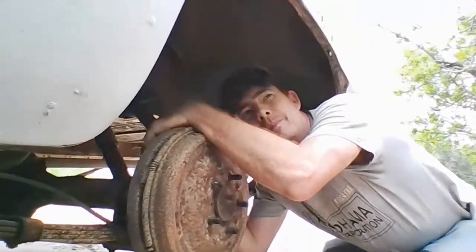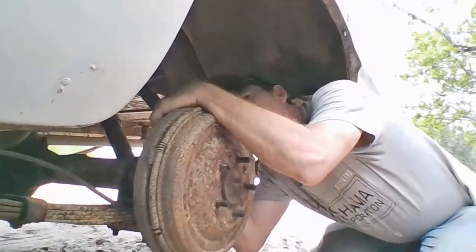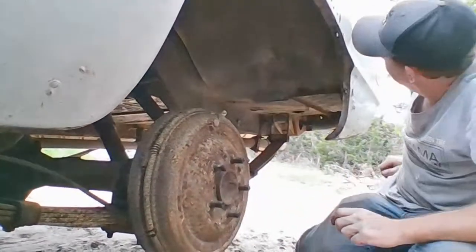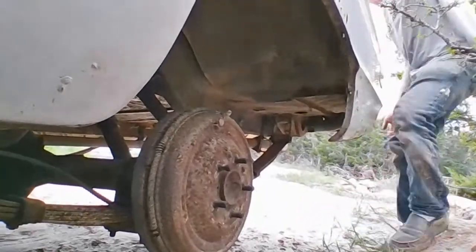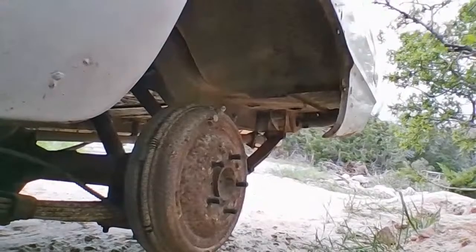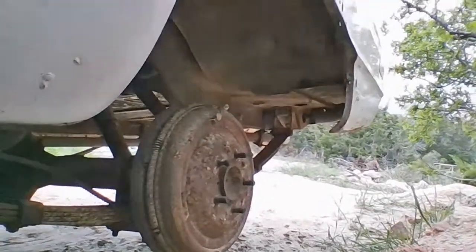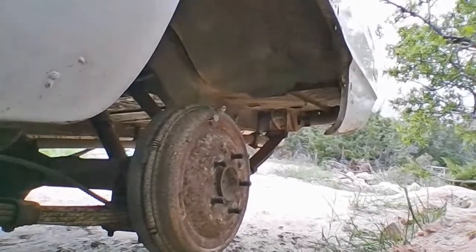Okay. Down. Let up. Might be too loud. Down. Up. Let's check the fluid, because it is a small master cylinder. Oh, yeah, it's already going down. We're getting air out the other end here, too.